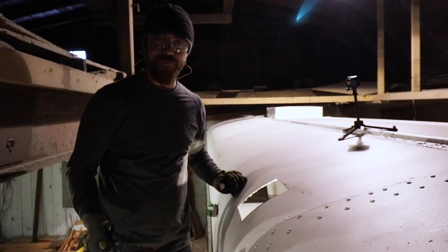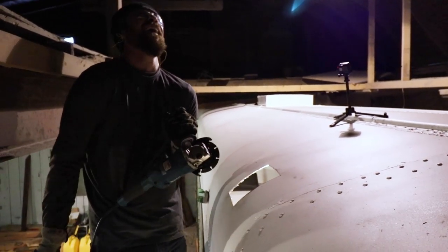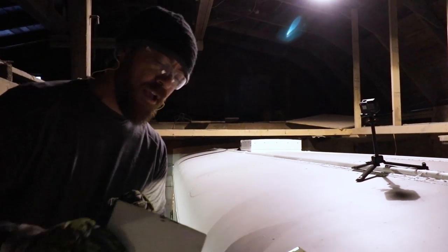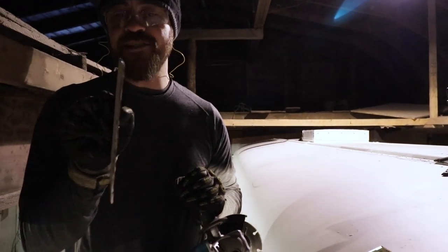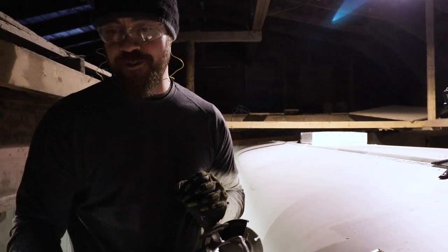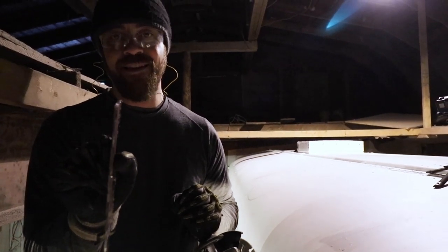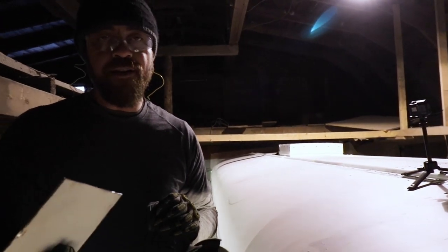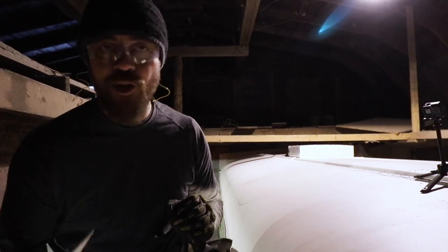There's a hole in the roof of our bus! Do you like that tool? I do. How do you like the diamond blade? The roof is a lot thicker than the side panels — by like two times at least. So that rules out the tin snips we were going to use. This is too heavy duty for that. The shears are rated to 16 gauge and this roof is probably close to 12 gauge — the smaller the number, the bigger the material.